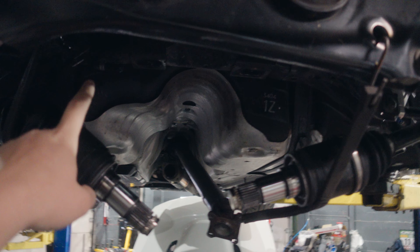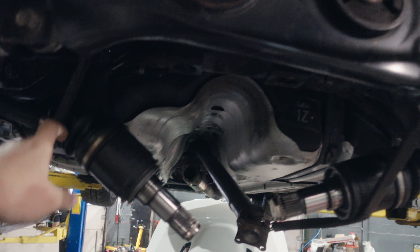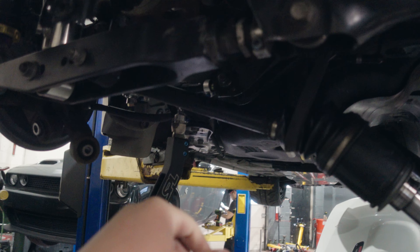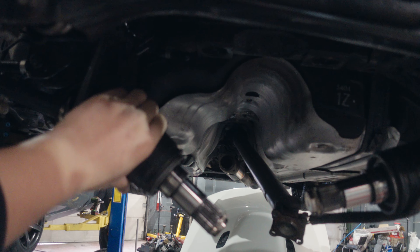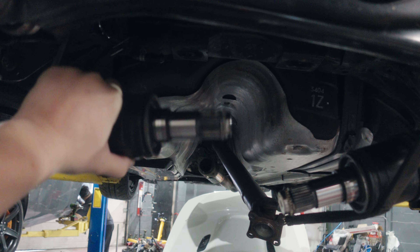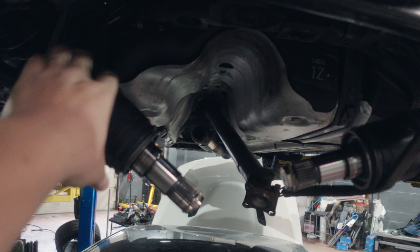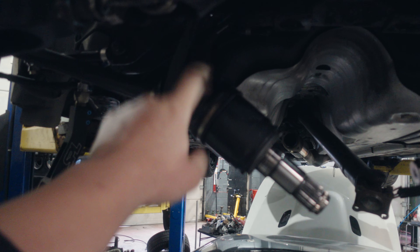Just so we're all clear, this driver's side inner CV is usually the one that always breaks — it's always the bearing cage inside. Part of the reason why is when we lower the car, the angle of the shaft gets more and more severe as that part of the suspension moves upward. This is a flex CV, and the angle that it attaches to the diff is going to be like this. That contact point puts a lot of stress because it's not straight — it's elongated, and the surface area for contact in the bearing cage gets more and more strained. It becomes prone to cracking.